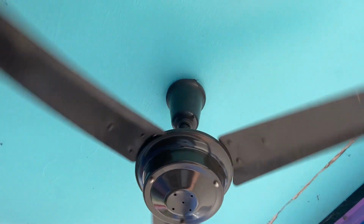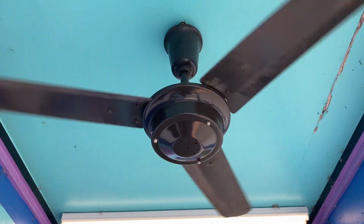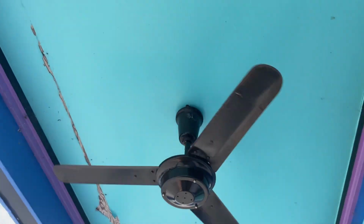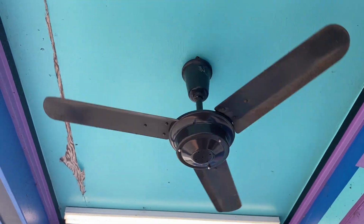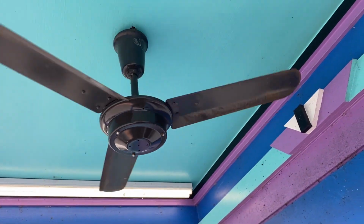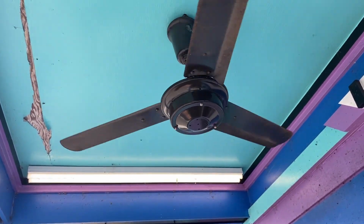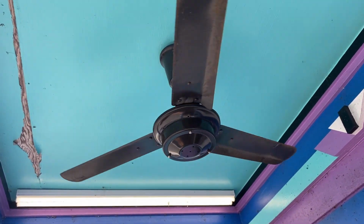Let's see how bad its spin down is. I want to see how this spin down is. Worst fan of the night. Always gotta say that. Seems to still have a decent spin down. Surprised at its spin down. I think I turned it off just in time a couple of months ago, before I did too much damage, so I could just re-grease them and it should be okay. Because you're right, the bearings are making noise, but the spin down is still okay. So it's just time to open it up, get in there and re-grease it. Definitely.